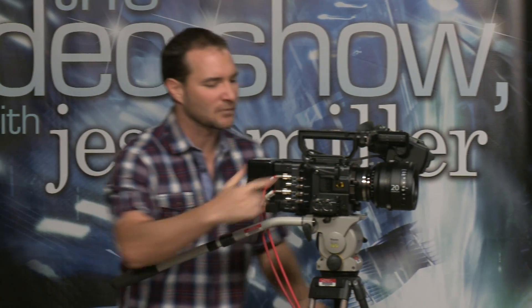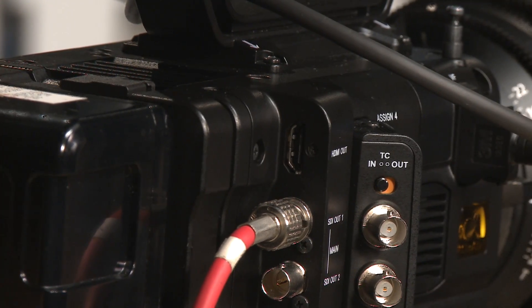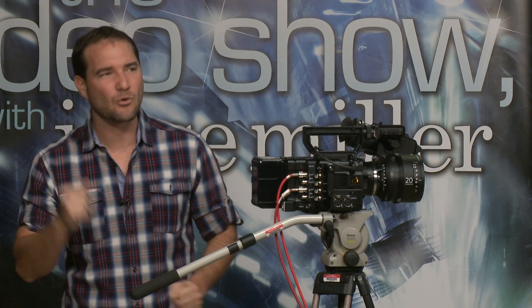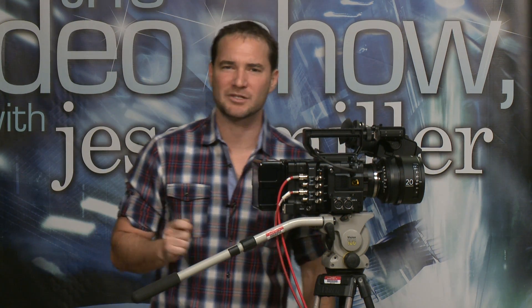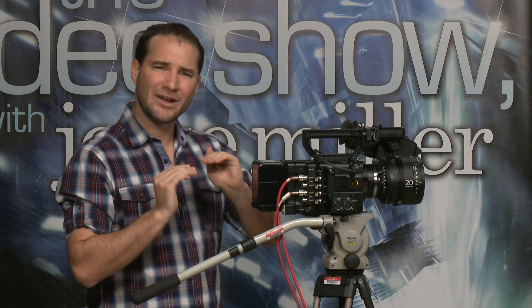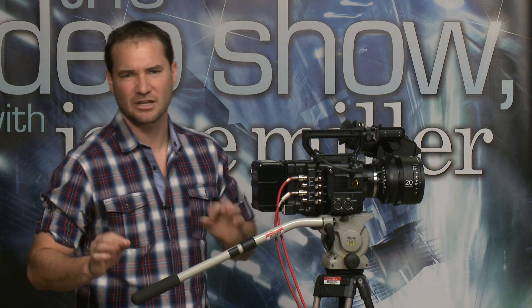It's important to note there's an HDMI output right here. HDMI is going to give you 1920x1080, 2K, or 4K resolution — it's HDMI 1.4. So if you've got a 4K HDMI monitor that sends EDID information and requests 4K resolution, this camera is capable of pushing it out through HDMI. There are also two main HD-SDI outputs, which are always clean, and two sub-HD-SDI outputs that can carry viewfinder and lens information for your engineers.